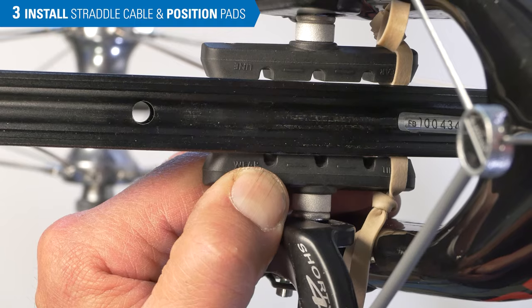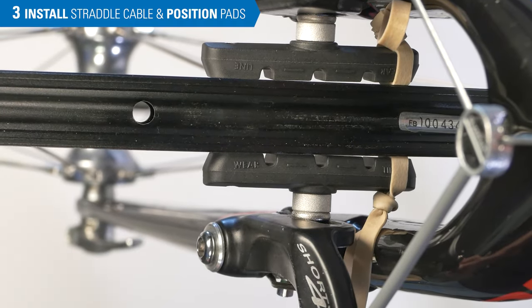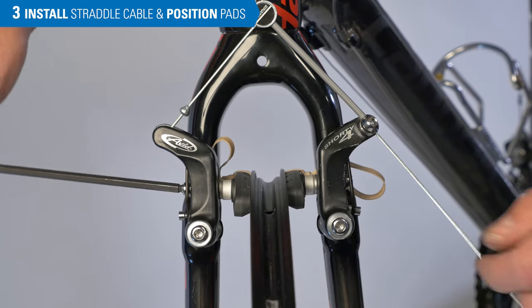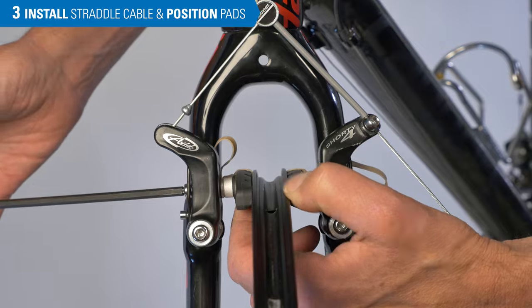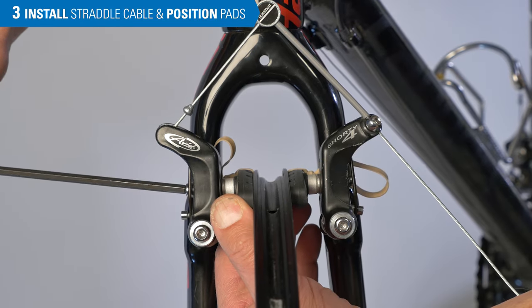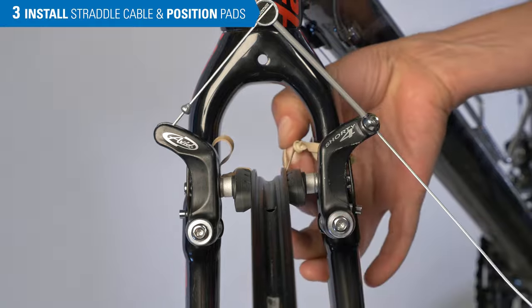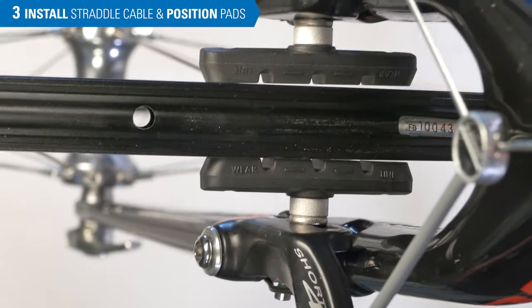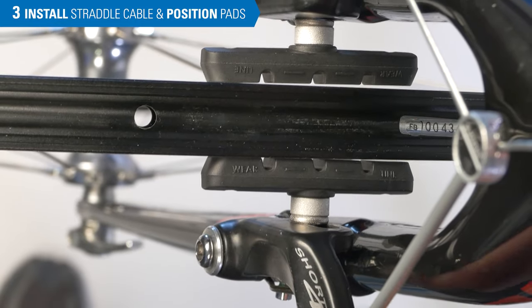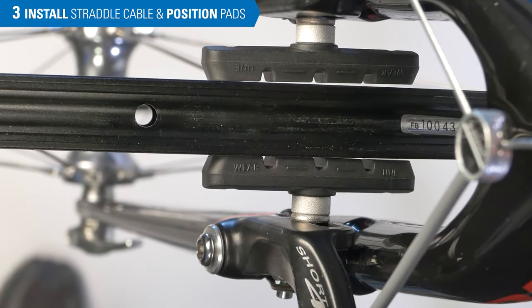With mild force applied, we secure the pinch bolt. When we loosen the nut, we can move our height and adjust the vertical face. Because it's pressed against the rim, the stud is going to tend to self-align with those convex concave washers. Once we're happy, we secure the nut and repeat on the other side — getting good height, getting the front edge and back edge even, then securing. The shims are removed and we have a slight gap at the back. That is our toe.